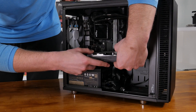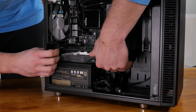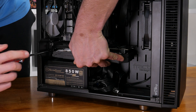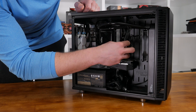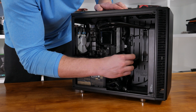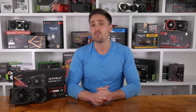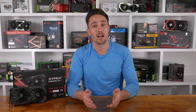The key part of the plan was to change my test system for these lower-end/mid-range graphics cards to something that would more closely reflect the setups those shopping for a sub-$200 GPU would be running. This meant dumping the overclocked Core i7 6700K system for a more affordable Core i3 rig. In the end I went with the Core i3 6100T, which is roughly three times cheaper than the 6700K. I deliberately opted for the low-voltage model as it comes clocked at just 3.2GHz and will better reflect the performance of locked processors. That said, for this review I wanted to try doing things a little different to the norm.